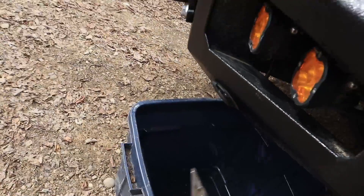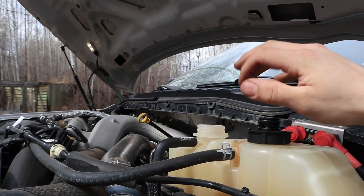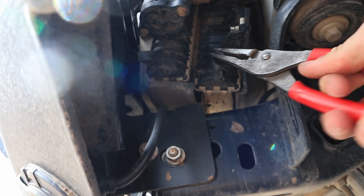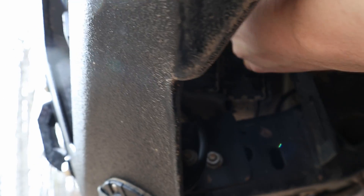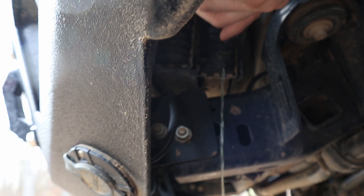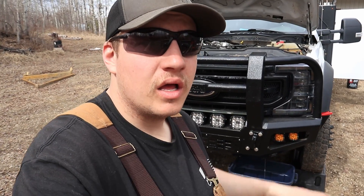Let's get it up on the ramps and get the coolant drained. First off, you want to get yourself a good bucket — it's an 18-gallon. Get yourself a nice big tub, pull your rad cap, get all the pressure off it, and it'll help siphon. This is your green petcock on the rad. Just take a nice pair of pliers, be gentle with it, give it a quarter turn, then a half turn, and just let it drain. You can take that petcock valve completely out and it will shoot coolant — if you want to do it nice and clean, just get it coming out slow. Give it about 10 minutes, have a beer, and come back — it should be drained.